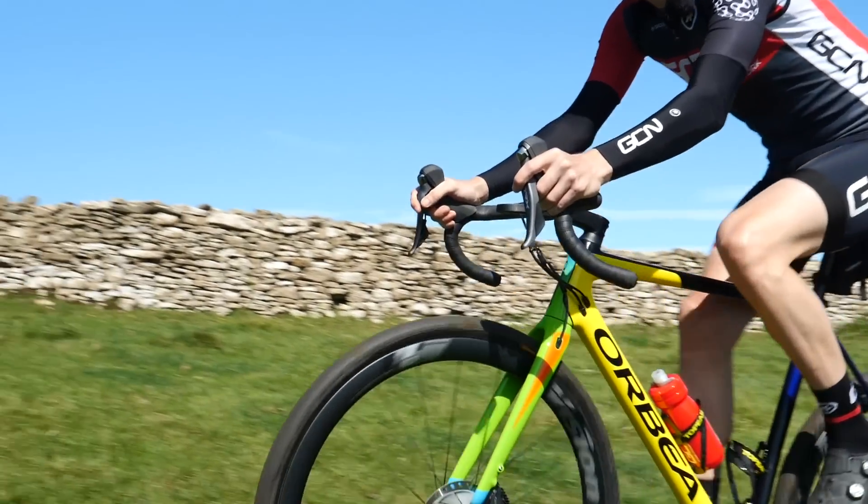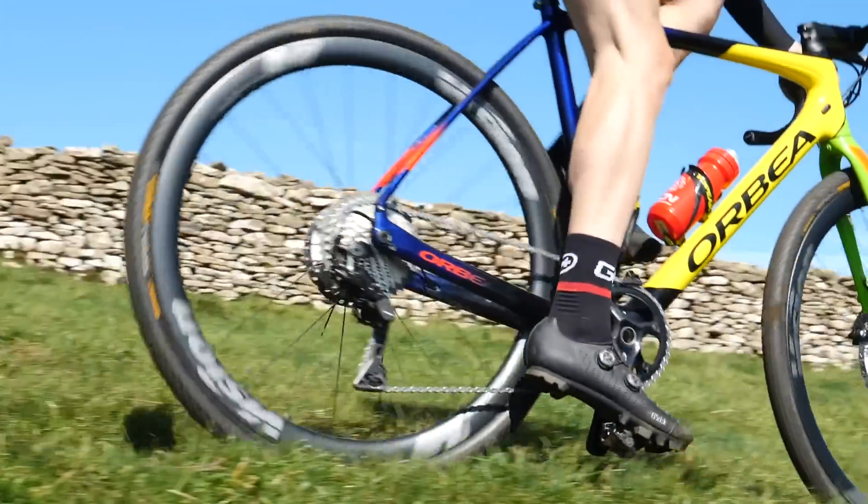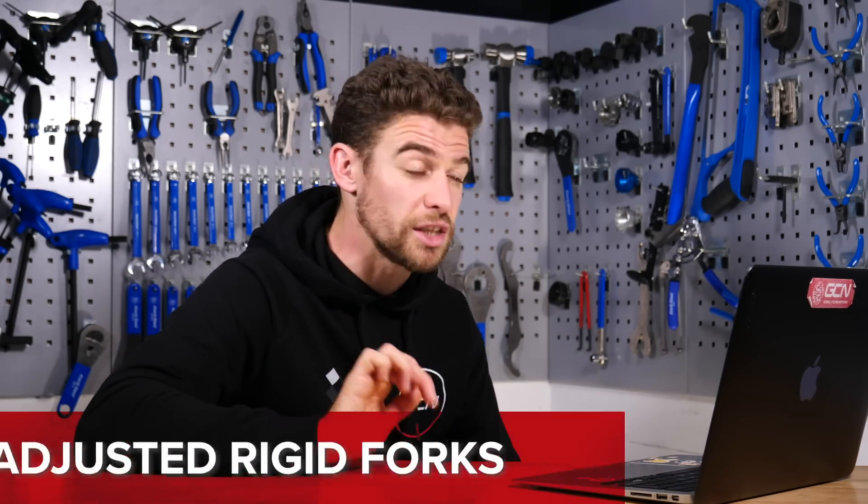Moishe Yewunda wants to turn his 2012 Trek 8.2 into a gravel bike. He has everything figured out but doesn't know what to do about the front fork. Currently it's a 60mm suspension fork and he wants to ditch it for something more road-worthy, asking whether a normal fork will alter the geometry too much. You can absolutely buy geo-adjusted forks — these are forks designed to fit bikes that were made with suspension. They make the legs of the fork a bit longer, which props up the front of the bike, maintaining the geometry whilst the suspension is not compressed. For example, if you need a 69-degree head angle with forks around 445mm axle to crown, these longer forks are designed to do just that. Simply swapping for standard forks may not work, so look for geo-adjusted forks.